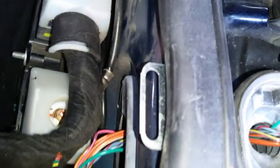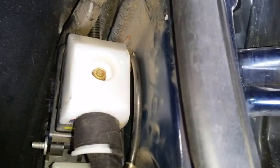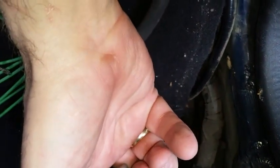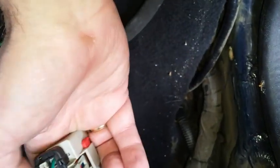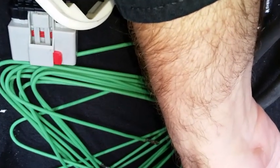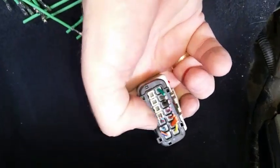So it'd be a matter of using a multimeter, but you can use a test lamp with a battery, to test the continuity between the green wire coming out of the new connector and the pin position you want it to be at on the harness. So you do the continuity check on the green wire on the new harness coming out of this position, and make sure, because in my case, there's going to be 10 green wires coming out of this connector at one time. Find out, okay, I found the continuity. I found which one of the green wires is on this terminal, and I want to bond that green wire to the wire that had that color, which in this case looks like gray with a red stripe, or some sort of light blue with a red stripe. And then continue on.